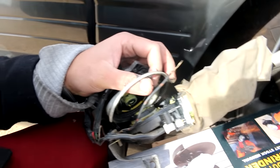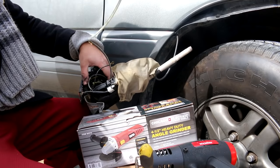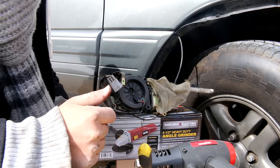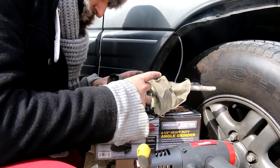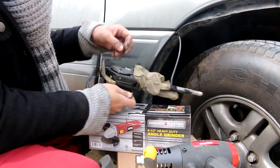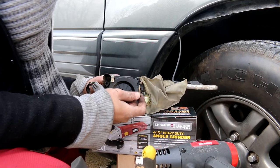This is the old one right here. Taking this out — you can see it broke off pretty much right at the end there. All of it's broken. It looks like there's enough sealant there that I don't need to add another layer — I think once I squeeze it back together it will be tight again. There's plenty on there. Note: when you take off that center screw, there is a nut on the back side. There's an opening on the back side and that nut will fall out. I luckily had it land right here and I found it. So if you're wondering why it's not screwing back in, it's because that nut is not in the back.